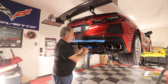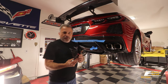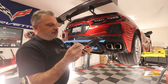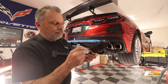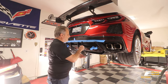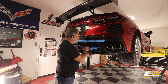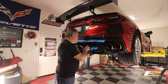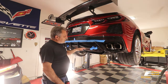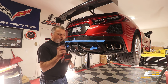We're going to pull our first fin. I had tape up here to hold it in place, so we move that out of the way. That reveals I've already put the sticky tape on here and I have my little hole right there. All I'm going to do is put a little bit of dielectric grease right there in the hole. Now that I've got everything marked and I know exactly where it's going to go, we'll put it up on the trim, get it right where it goes, and carefully push it into place. Then we pull it off, we can see our grease spot right dead center, and we'll take a very small — I think it's a 1/16th — drill bit, really really small, and we're going to make a pilot hole.